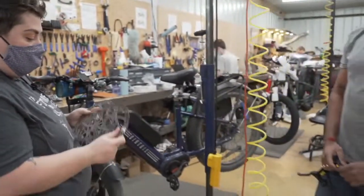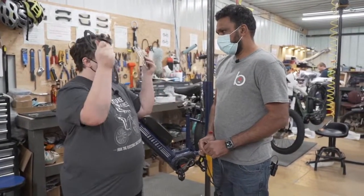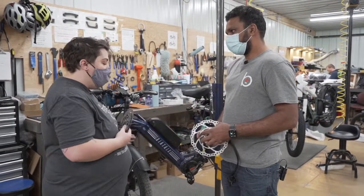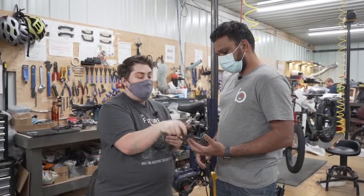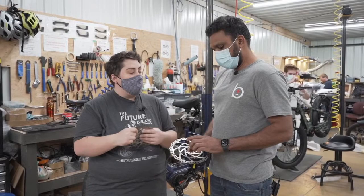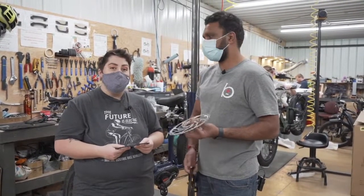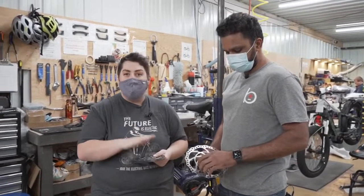So DJ, what's the advantage of having different sized pistons and different sized rotors? With the bigger rotor, you'll have a bigger area to hold on, so it will have more braking power. The bigger rotor paired with the bigger caliper and more pistons — that's just more braking power with more rotor for those brakes to grab onto. Who would want that kind of setup? We recommend Magura or quad piston brakes for off-trail riding for sure. If you are more of a trail rider then you need that better braking power — it's that great extra level of security, stopping power, safety.